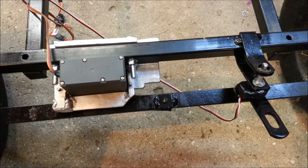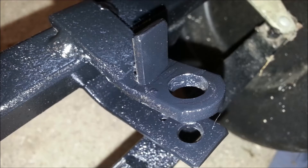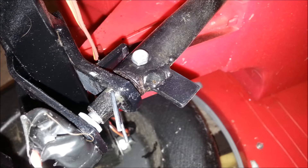Here is the system completed. You can see some clearancing on the aluminum mount, which is bolted to the frame. We can also see the potentiometer that will mate with the stock steering shaft. The lower tab with the smaller hole was welded on — that's what the potentiometer actually mounts to. There's a little vertical tab piece that acts as the steering stop to prevent oversteering, and there's a steel tube inserted into the steering shaft to act as a universal joint to connect to the potentiometer. That little tab sticking off to the side will interfere with the steering stop in either direction. The first video is an initial mock-up and then after that is the final setup.